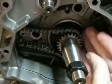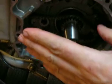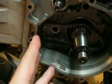You drop the chain down the hole, it falls through and piles up down there. Usually it's sitting on that back gear. I had some trouble getting mine out. There's a flange right here — the gap through there is narrower than the chain. So you get the chain all dropped down in and you can't get it out. What I ended up doing was pulling it out and picking it up so it's at 90 degrees, then pushing it back in and up. I was able to flange it out that way, because then it's narrow enough to come out.